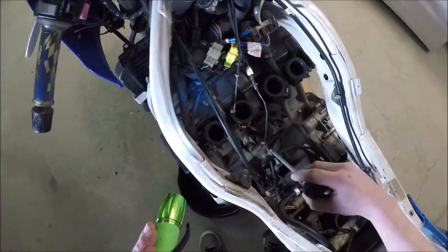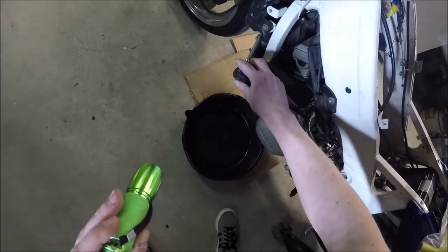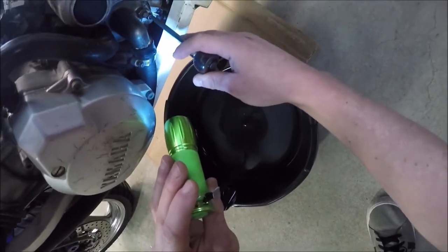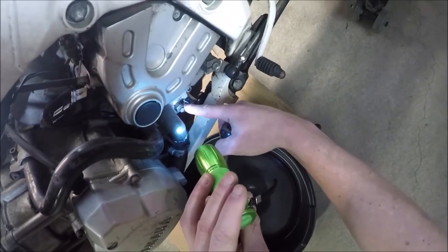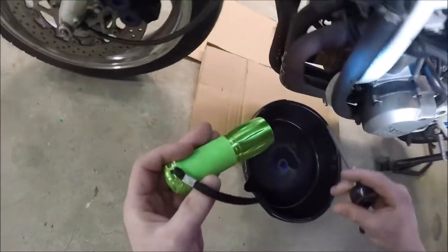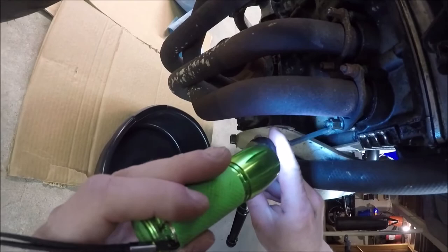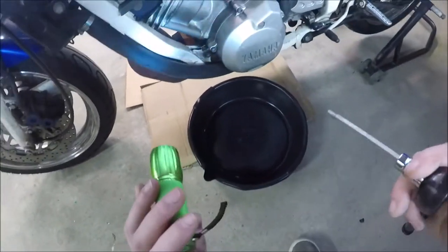The problem is this entire thing is full of coolant all the way to the top. So I have to drain it at least down to the bottom of the radiator — I'm essentially pouring all the coolant out. The coolant will come out at the pump drain here, which has a washer under it. There's also one under the exhaust — it looks like a 10mm hex with a Phillips in the middle. Take it off with the hex, drain it from there. I'll just do a full coolant swap on this. It's the green stuff, ethylene glycol.